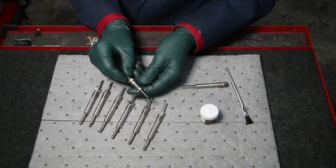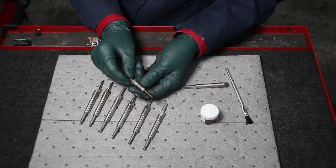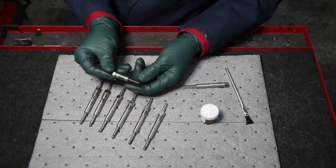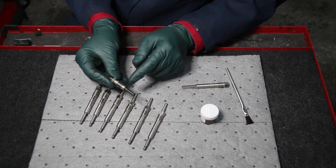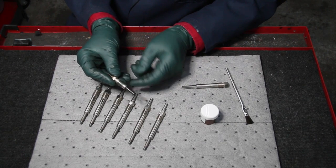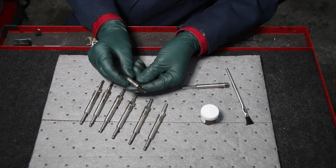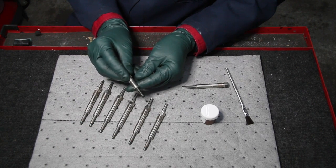This is the glow plug that was used in Mercedes diesels from 1980 up through 1993. Notice how short it is compared to the ones here. Up until 1985, on the OM616 and OM617 engines, these were installed into cast iron heads — steel going into an iron cylinder head. I've heard of them breaking off in OM617 engines, but that is really rare and it's probably due to abuse. I do recommend a light coating of anti-seize when installing these even in the older engines, but it doesn't seem to be as critical.